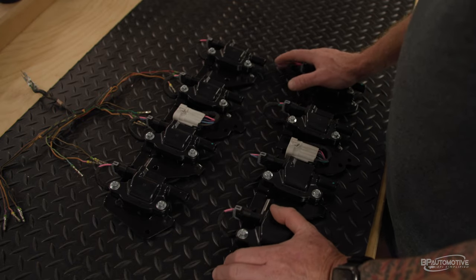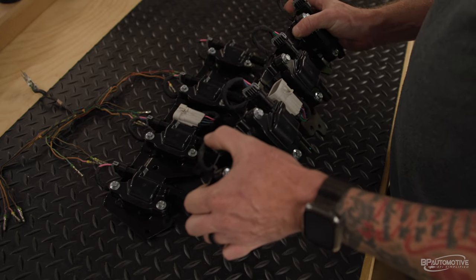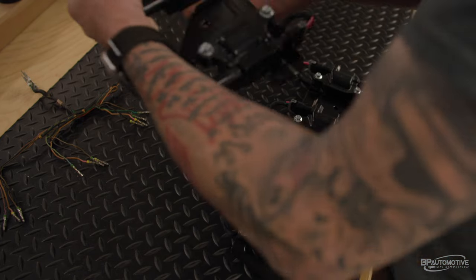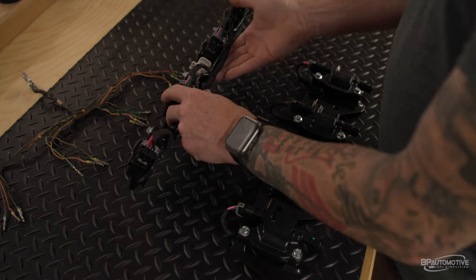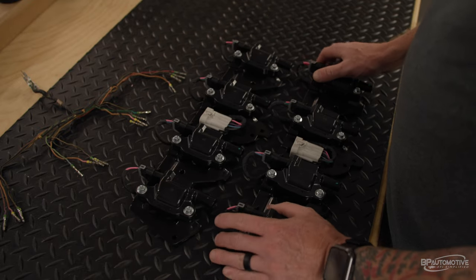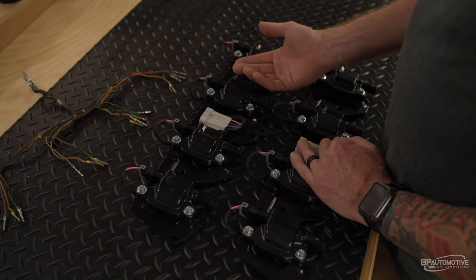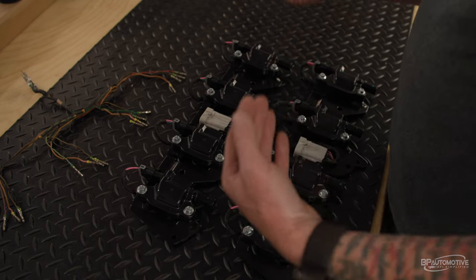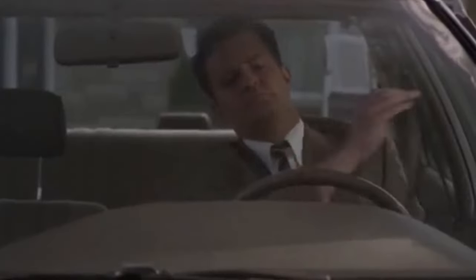So red will always be on the right. On the driver's side these will go purple, blue, green, red — with the purple wire at cylinder number one. On the passenger side it'll be exactly opposite: you'll have your red up front at cylinder number two, and then it's red, green, light blue, and then purple. Where some customers mess up is they'll assume that one side needs to be opposite of the other, and they'll make it opposite. Then when they have a misfire or it sounds like it's out of time, they'll just flop one bracket to the other side and it still sounds the same.